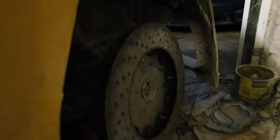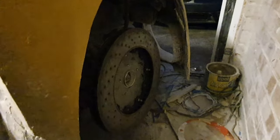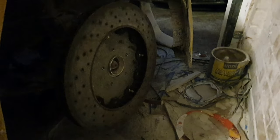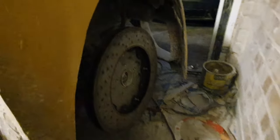The next stage is to check the clearances - I need to finish these holes off, get it bolted on with the wheel, then test the clearance for the caliper against the back of the wheel. I need to make sure it clears the spokes and will still turn. I'm doing the front first since it's the harder one - the rear is the easy one. I'll crack on with this and do another video at the start of next week.